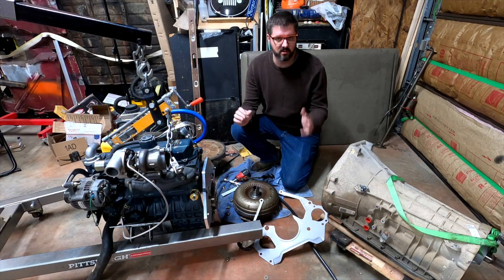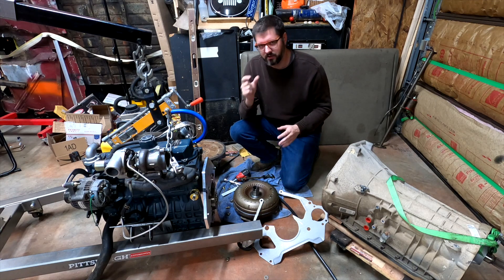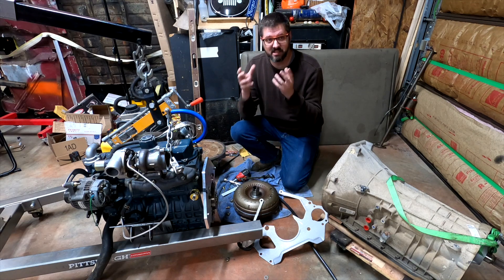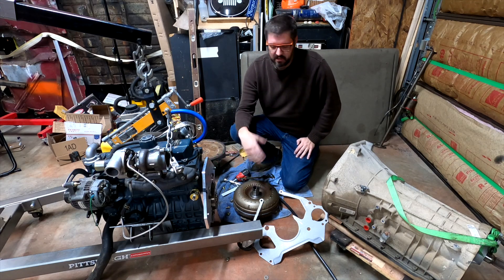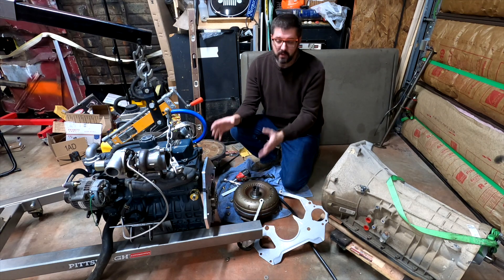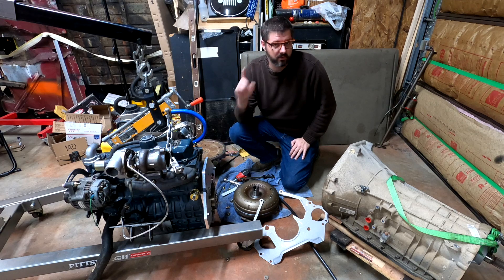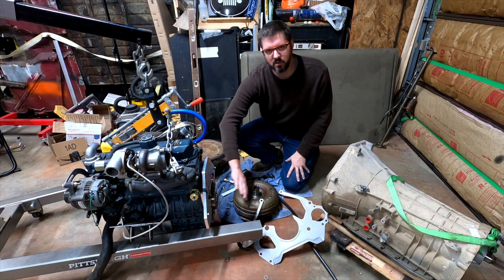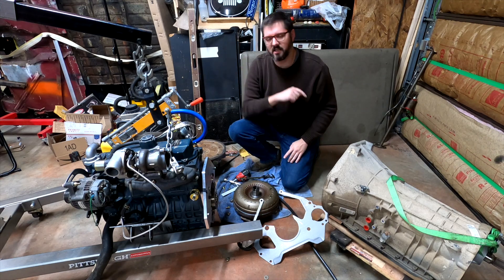It's been a couple of days. I've been talking to Kubota Swappers, and what we discovered is the crankshaft adapter is about a hundred thousandths of an inch too long. The reason for that is he had a bad batch of these adapters and couldn't find the last bad one — turns out he sent it to me. I've had this kit for well over a year, so I'm not upset by it. Another one's already on its way, but mail is slow right now. This is really the reason why you want to do this on the ground — if I had gone ahead and put my Kubota V2403 back in my Wrangler, trying to figure this out would have been a nightmare. As soon as the new crankshaft adapter gets here, I'll remove this one, install the new one, do another test fit, and see if the engine spins over freely.